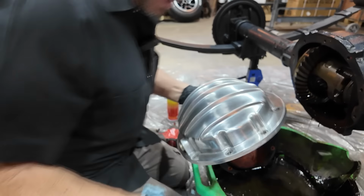For the lug nuts in the rear, since I've got these extended studs, which I got because I was running a wheel spacer and a very deep aluminum wheel, and I wanted thread engagement. Sue me. Anyway, what I did is I bought these, just a racing washer. They're just parts store stuff, but I cut the ends off of them so that now we can have our proper thread engagement, the proper offset. The washers fit super nice inside the reliefs for these wheels. So it's just going to look a little race car, but if I end up running this setup, it'll be safe.